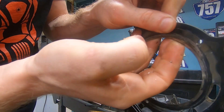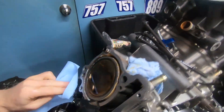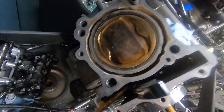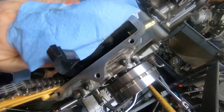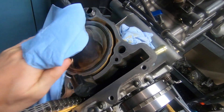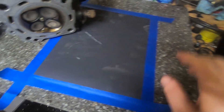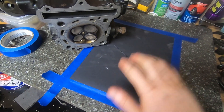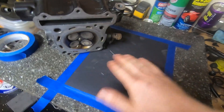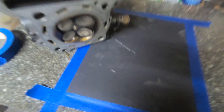I'm just going to clean up this piston, clean up the cylinder head here, put it back together, get her in the bike. What we're going to do is — I wish this was a lot bigger — but you need something that's dead flat. This is a piece of granite countertop that is flat. We tape a piece of 400 grit sandpaper on it, go to 400 grit then 600 grit. You just do tiny circles or figure eights and try to get the head a little smoother, since we don't really have time to take it to a shop and have it planed.